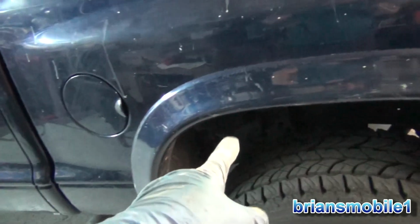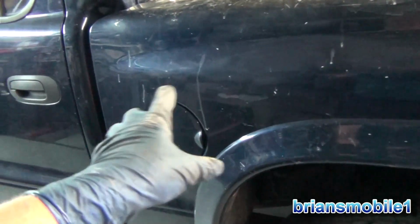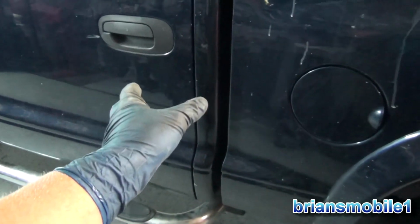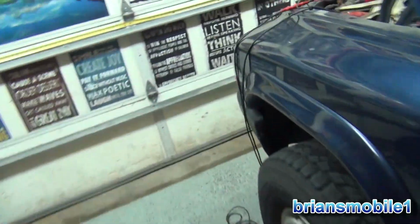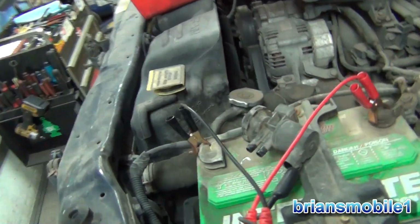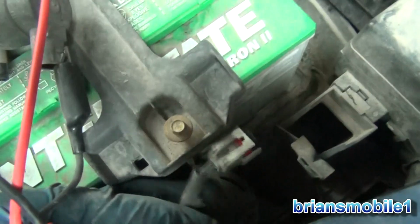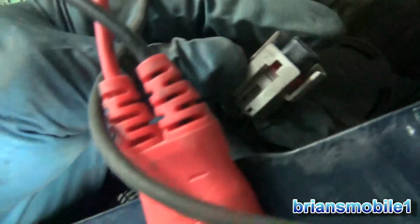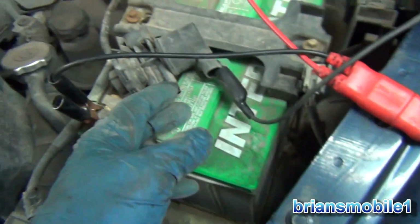So basically you get the tank, your hydrocarbons or your gasoline, the vapors get stored or held in a compact area in the charcoal canister so they don't leak into the environment. And then when you start your car up, you've got a little plug that plugs into it. It's got the positive and negative, right. Here it is. You've got one side, it's always negative. That's the wire on the right side looking at this one. And then your computer sends a signal to this and says, open up.